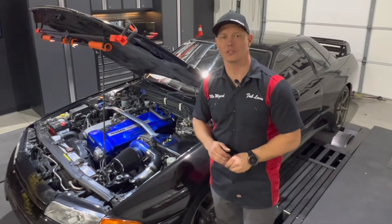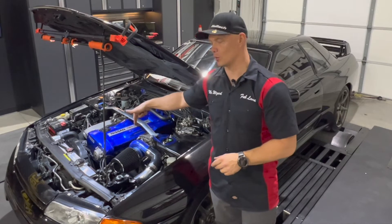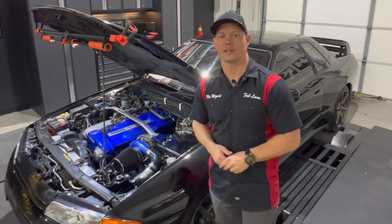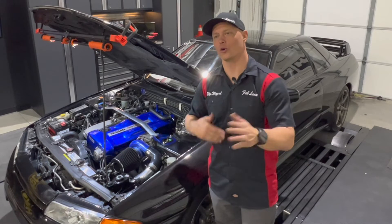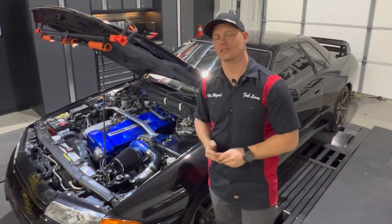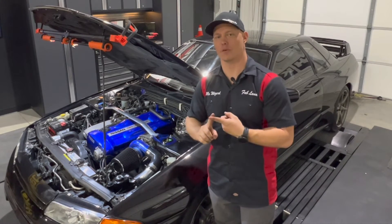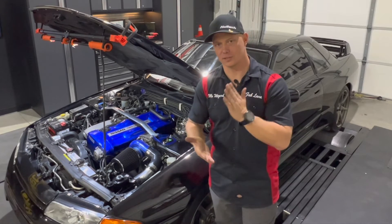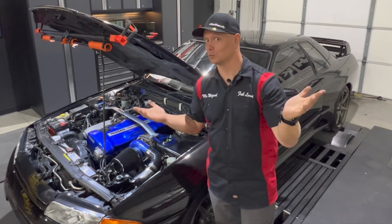In this instance I'm going to be removing all six plugs. Engine is up to operating temperature, so it will be warm. With all six plugs removed, during cranking with the gauge installed, I'm going to be at wide open throttle and rotate the engine over a handful of times until I've got the compression numbers or it gets as high as it will allow. I'll repeat that process through all six cylinders with the same number of rotations to ensure repeatable results and consistent methodology. Comment below if you think I'm right or wrong.